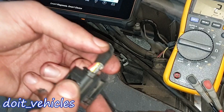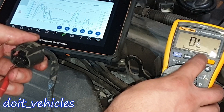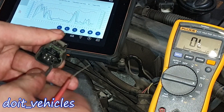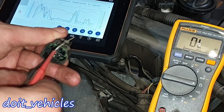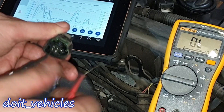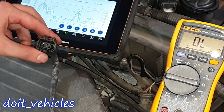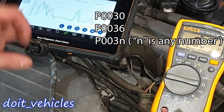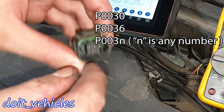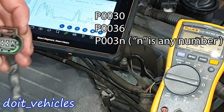The white and brown wires are usually for the heater circuit. Between 3 and 4 — nothing. 3 and 5 — nothing. 4 and 5 — still nothing. If you have a trouble code indicating an open on the oxygen sensor heater, testing these two middle pins should give you 2.7 ohms.